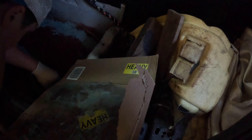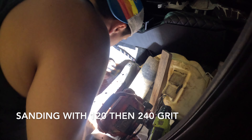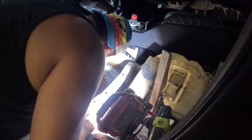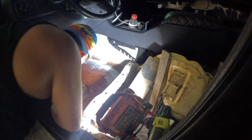The factory insulation held in moisture which rotted out the original metal. The sheet metal on these floors is really thin. I upgraded to about 18-gauge steel to make sure it's a little bit thicker than factory, which will also extend the life of that floorboard area against the elements and corrosion.